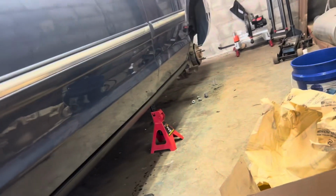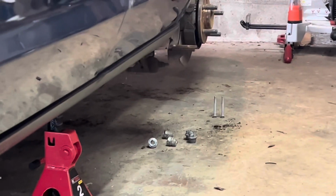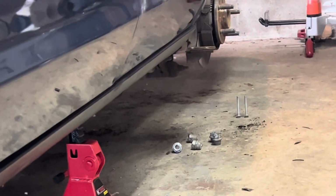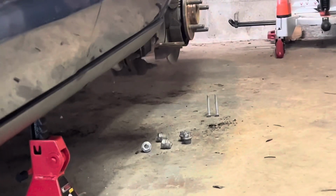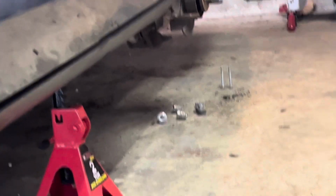Let's discuss the rear brakes. Now, of course, I haven't put them on there yet. You see those little pins sitting on the floor down there? Those are your rear caliper bolts. The appropriate torque spec for putting those on is not 27 foot-pounds, it is 20 foot-pounds. 20 foot-pounds rear, 27 front, brackets, 118.